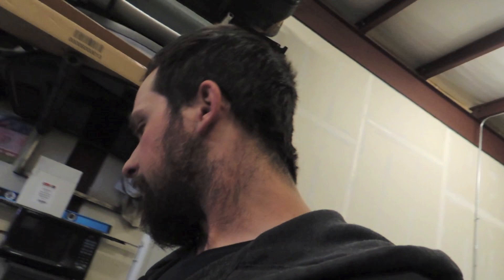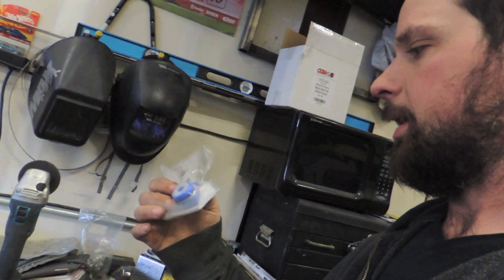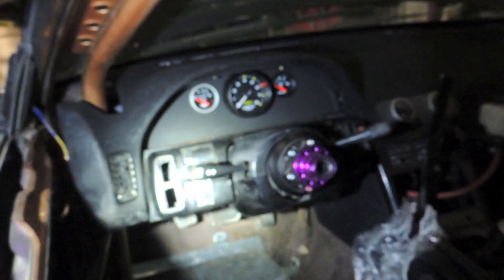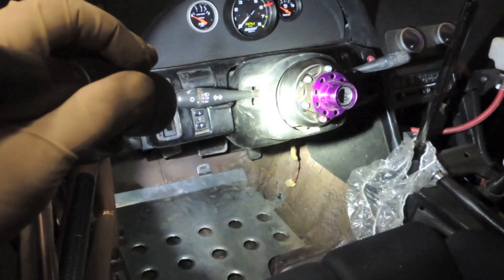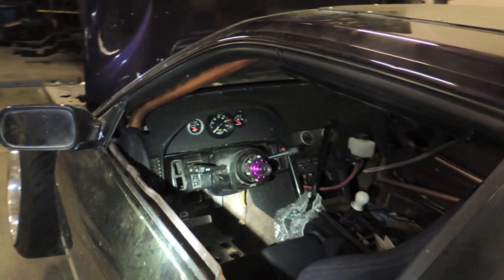Still waiting on the suspension for the 55 Chevy. Mike's car has not been painted yet — still at the paint shop but still hasn't been painted. Glenn is bringing back the Raptor that I built the exhaust for — it needs some stiffer hangers on the very end of the exhaust where it pokes through the bumper, because when it gets hot it moves and barely touches the bumper. I'm going to put more rigid hangers in it like what I did on the Pontiac — these nice weld-on stainless ones that have the polyurethane isolator. Got all the trim basically around the cluster, repaired that lower piece, got the column covers in — it's basically looking the way it should. Now that's all done I'm moving on to the subframe.